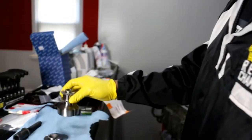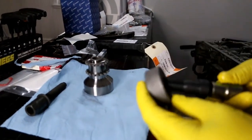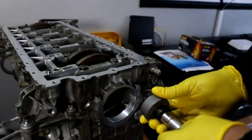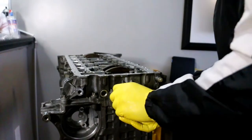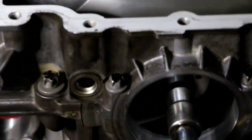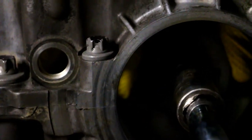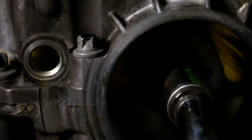This kit came with a jig. I need to bolt it to the crankshaft. I did some research — it doesn't matter which orientation you put it in because you can still sync up the timing. I'm going to screw this in first. Even though it's not necessary, I put cylinder number one at top dead center and I'm going to put the pin holes at three and nine o'clock.